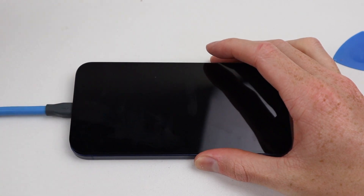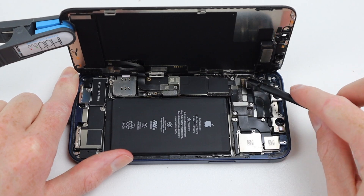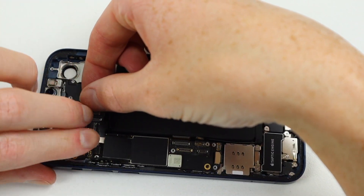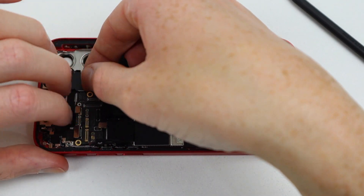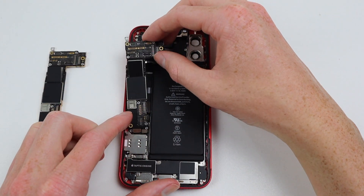I'm happy to see they fixed the issues with the camera. I honestly believe it only happened as a result of the massive coverage from my iPhone 12 teardown video, and that got me thinking — I wonder if anything else has changed. Maybe True Tone won't disappear after a display replacement, or maybe the battery health now won't be disabled. So I'm going to rerun all of the tests from the original video by swapping the logic boards between the two phones.